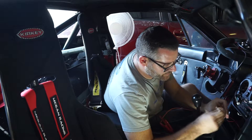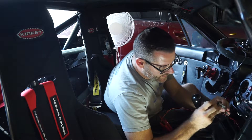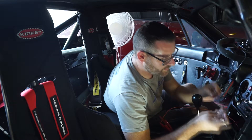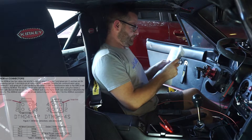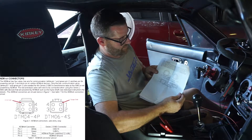For reference, AEM net is generally white and green — white being CAN high, green being CAN low. These connectors are pretty reusable, which is actually pretty nice. I can de-pin this and hold it for later. As a quick reference, with the connector itself, they actually send you a pinout card telling you which pins go to what — CAN high, CAN low, power, ground — everything you need to know about what this connector is doing.